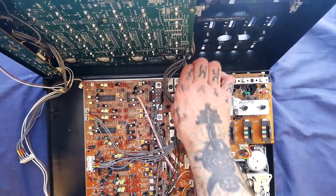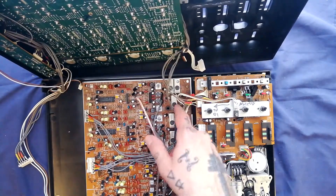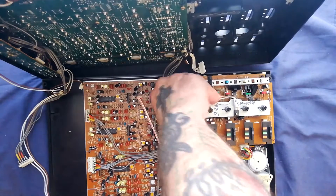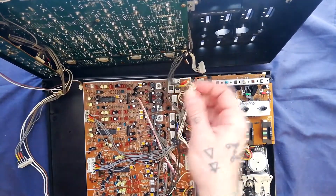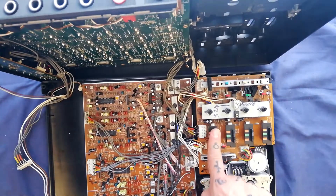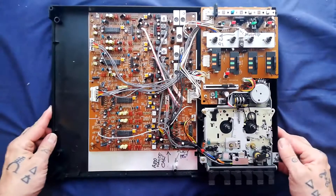Those cables look fairly strong, so I'm just going to pull those off. We've got two more delicate-looking connectors with thinner cables joining onto a shorter connector to the top left of the four tape EQ controls — grabbing the sides of the plastic connector itself rather than the cables so I don't damage them. The longer one is immediately to the left of the track arm switches. At that point, the upper part of the case comes free.